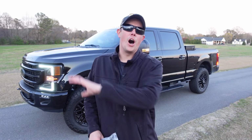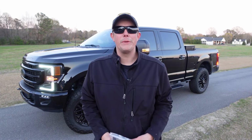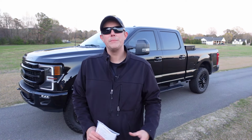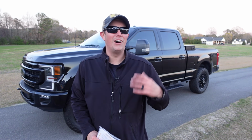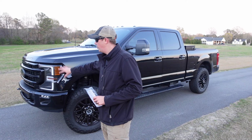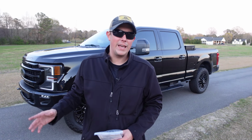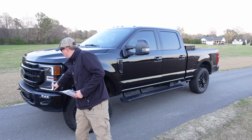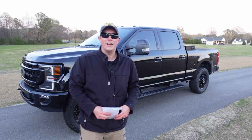And finally, guys, an honorable mention for our list is going to be ForScan. If you're not familiar with it, ForScan is a computer program or app that you can get to plug into your truck so you can make some minor changes to the programming and unlock some features that you might not know your truck has. For example, Ford does not allow you to have your fog lights on with your high beam. You can go into ForScan and in under a minute you can change that. You can also adjust the brightness of your outer LEDs here around your headlights. You can change your tire size, all kinds of cool stuff you can do with the ForScan app.